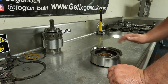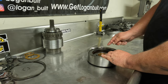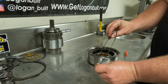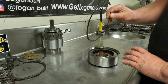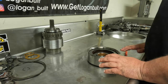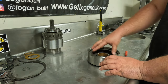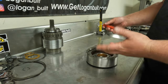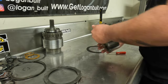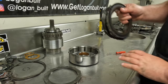The next thing we're going to tear into is the direct drum. To get the clutches out, just like the forward drum, there is a snap ring here. Now this is a waved snap ring in stock form — you're never going to want to use that wave snap ring. You're going to want to use one of the flat snap rings, because that wave snap ring is going to give you extra clearance in the clutch pack. If you set the clutch up properly, you'll actually have too loose of a clutch clearance with the wavy ring. That's why you need to run the flat snap ring. Save just the reaction plate and pretty much just turn it over to get all your clutches out. Throw all these clutches and steels away because we're replacing everything with what comes in the kit.